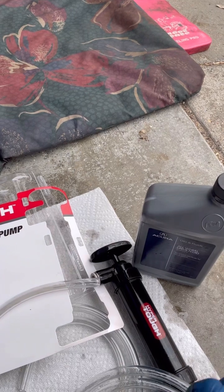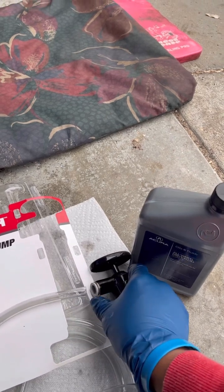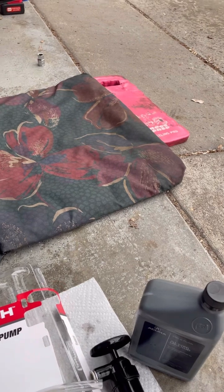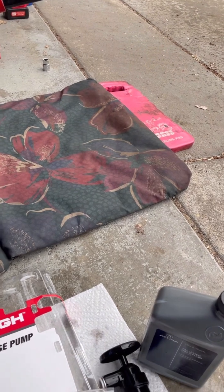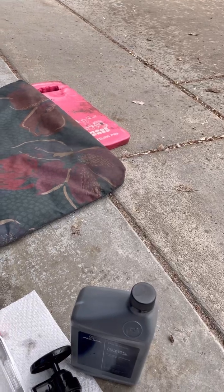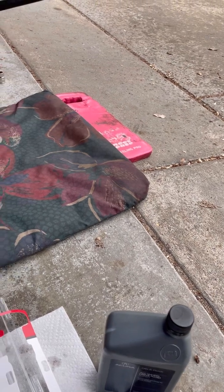You just push it down and push it in — I'm using one hand, it's simple. You push this down, then put the hose in and it comes back up — just a quick grip. So you put one end in the bottle and the other end goes into the back of the differential, and you just pump it in. I was just under there pumping it — it just pumps right into the differential.